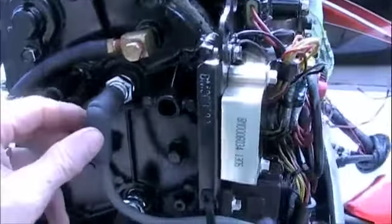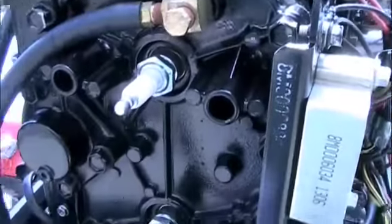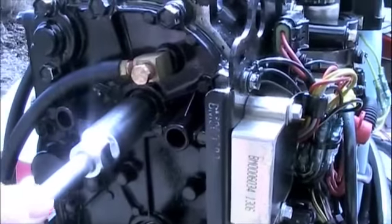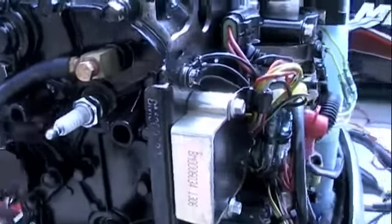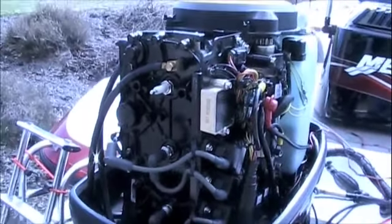Before you go to the lake this year, if it's been a couple of years since you've changed plugs, go ahead and change the spark plugs — it's a good idea. Simple to change, not a problem. Just pull the wire off, take a ratchet and a spark plug socket — it just slips on. There are two sizes of spark plug sockets; in this case use the large side socket. Turn them counterclockwise to take them out, clockwise to put them back in. New plugs give you better gas mileage and the engine starts easier. It's a quick, easy fix.